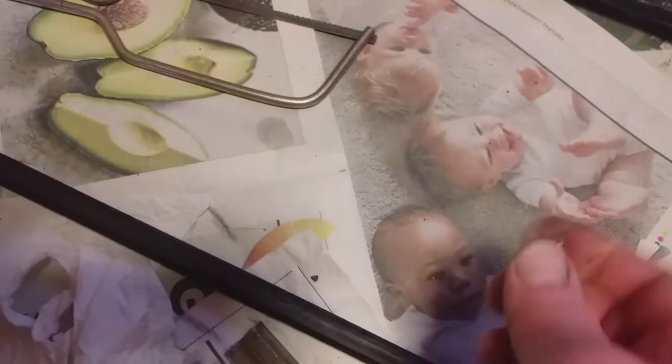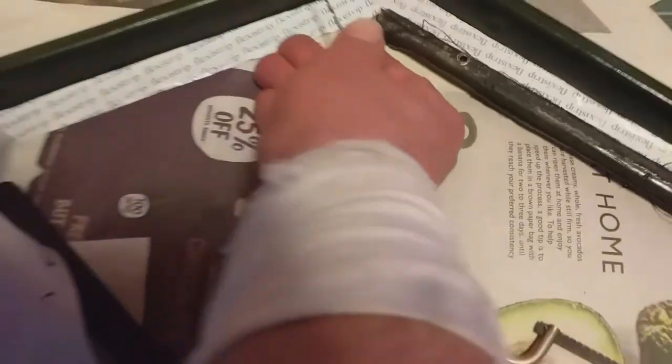You won't be able to drill it with the glass in place. The drill I'm going to use is a 1.5mm, and I've test-fitted it with the existing holes — as a rule it's a slide fit, though some holes look more like 2–2.8mm, but we'll cross that bridge when we come to it. I've got the old channel here lining up with the holes, so I'm going to use it as a template. Once I've cut the new one to size with a junior hacksaw, I'll lay the old one on top and drill the holes straight through to get them correctly located.